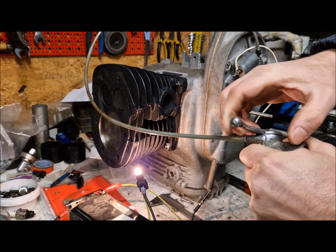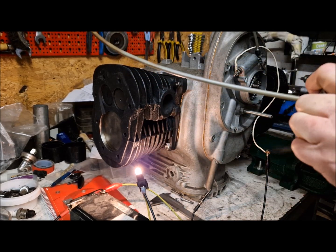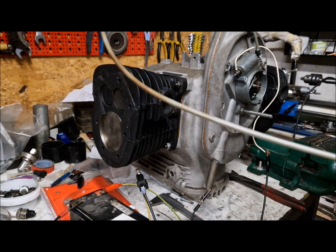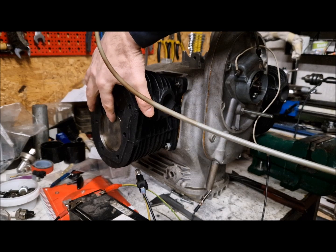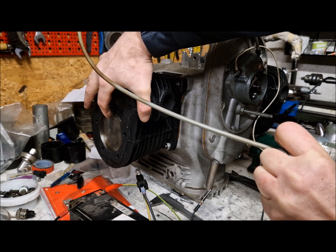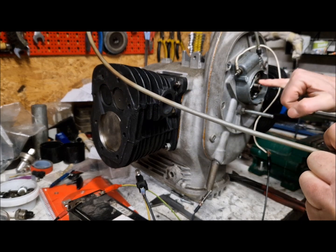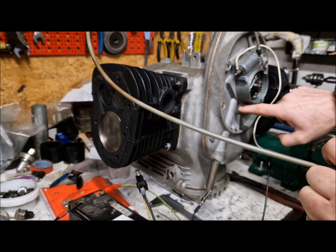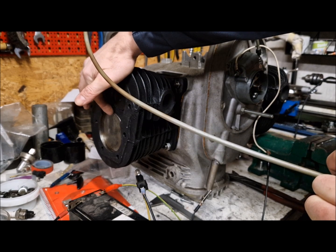This is the retarder, and if I retard the ignition, we have the lights on, and if we turn the engine a little, as you can see, we have spark because the points are open. When I have the ignition retarded, the piston is at the top dead center, which means the ignition timing is too retarded. This is because I have a problem with the camshaft gear and the points not giving correctly. But for this engine, we are good for starting with the spark on the top dead center.